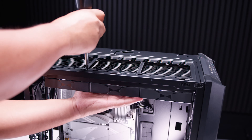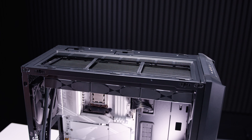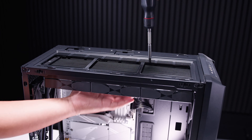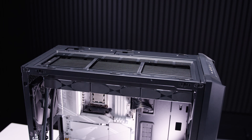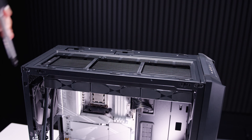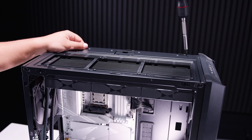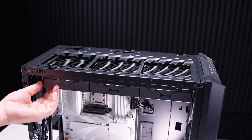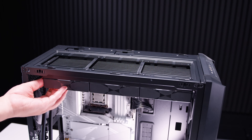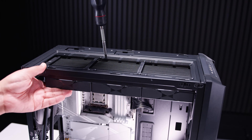I recommend with 360mm liquid coolers to fasten up one of the center screws first — when you do that, it holds the radiator in place. Don't fully tighten it because you'll want to keep them loose so you can make small micro adjustments later, in case you're not quite happy with the radiator placement. Rinse and repeat until all 12 screws are installed but not fully tightened. If your radiator is too far forward or too far backward, you should have a little bit of wiggle room. Once you've got it in place, fasten them up and we should be good to go.